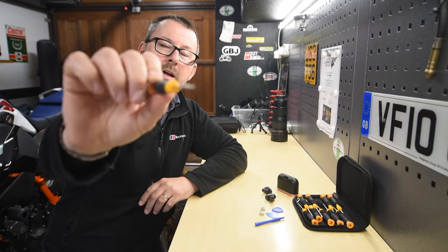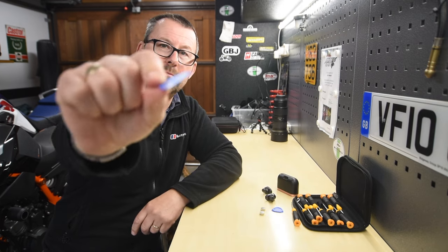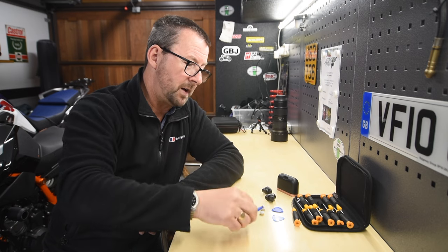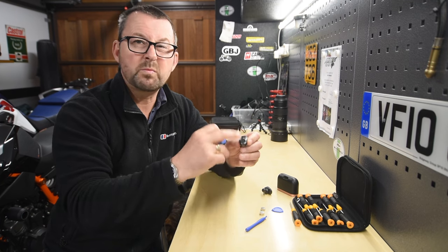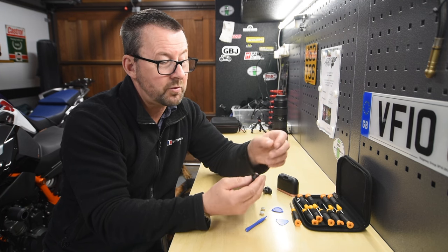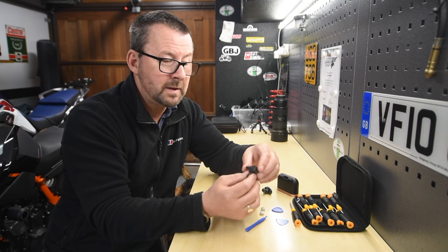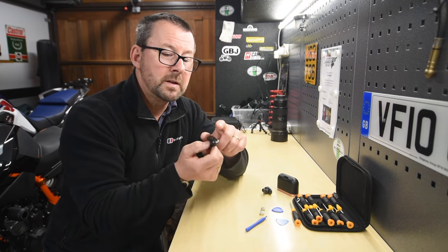So what do we need? We need a small star-headed screwdriver. If you've ever replaced your mobile phone case or screen, sometimes in those kits you get blue picks — I've got two of those — and also a plastic pry tool, which we'll use to remove the battery. The picks are used to insert between the top cover and the main body of the earbud to prise the cover off without causing damage. As a last resort, you can use a strong thumbnail or a thin flat-bladed screwdriver, though the latter could potentially cause damage.